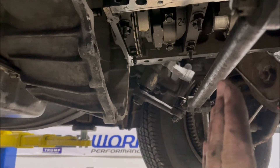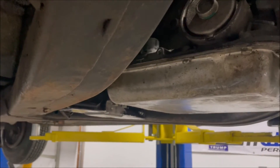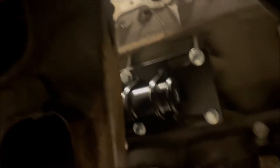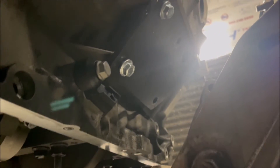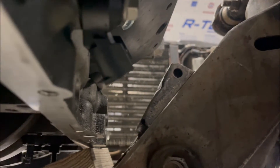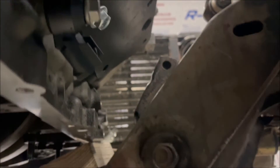This center link actually moves forward and backward a little bit as you steer, so we at least have a consistent point for the transmission and can slide it a little bit. What we're working on next is engine mounts. We've got these mounts here that would work really good — they've got little ears you weld to the frame — but the problem is they don't hit the frame, they're behind the crossmember. So we've got these other mounts that use a conventional small block Chevy mount, and we just need to make a pedestal. We've got the original frame mounts that need to come off. We'll raise the engine up, cut those off, then play around with the mounts and hopefully have this thing sitting in the car real soon.